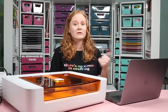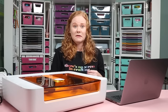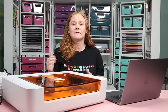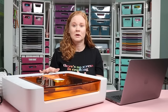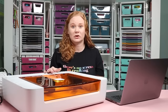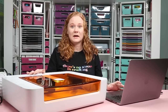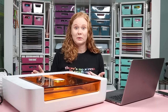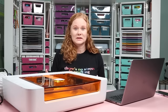At this stage you'll need your computer. Head to setup.glowforge.com and you may be prompted to download setup software that will install a program called Glowforge Wi-Fi Setup. Follow the steps, which include plugging the Glowforge Spark in — you plug it in to turn it on and unplug it to turn it off. Your Glowforge Spark is considered a printer, so you connect it to Wi-Fi, then use that Wi-Fi to connect to your computer. Once connected, the app will direct you to app.glowforge.com.